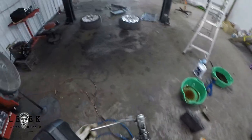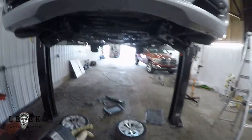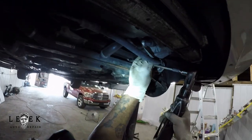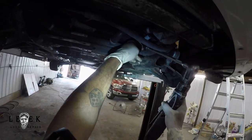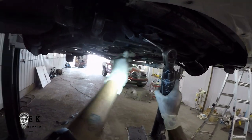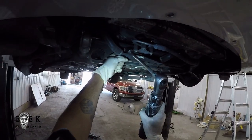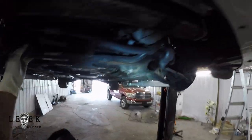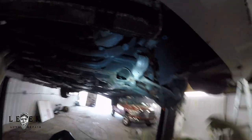There are two or three 10-millimeter bolts, and there's a coolant plastic cooler line that runs underneath the sway bar link, and there is a power steering cooler hose that goes in an S-form. You can see how I'm moving those 10mm bolts off — there's one more 10mm that lies on the frame, so it's basically a total of four 10-millimeter bolts on the very front of the frame you're going to be removing.